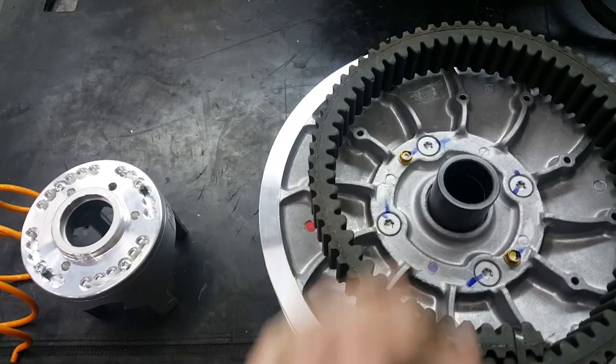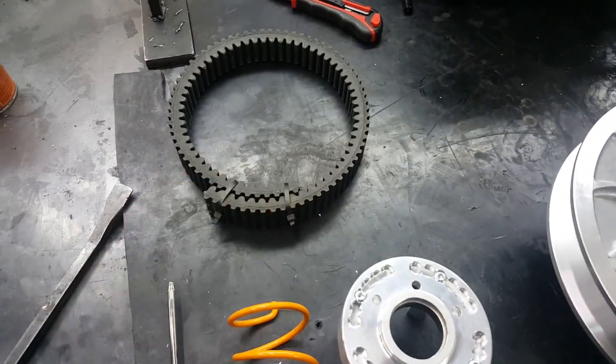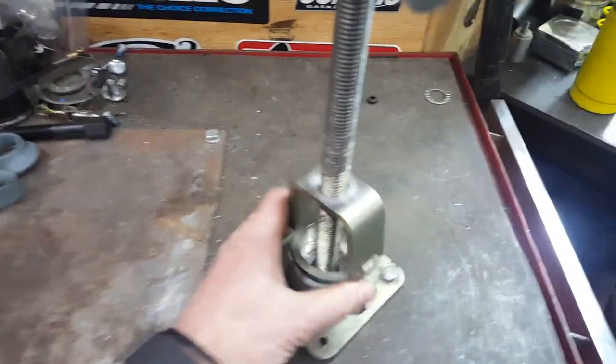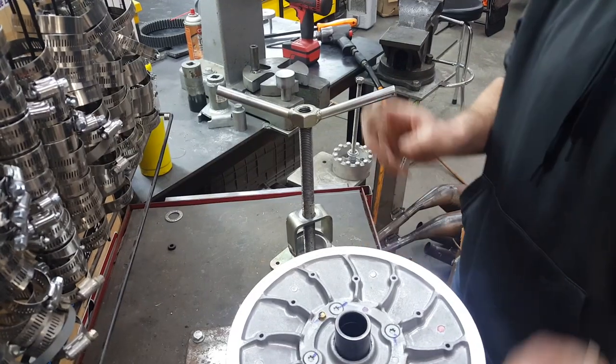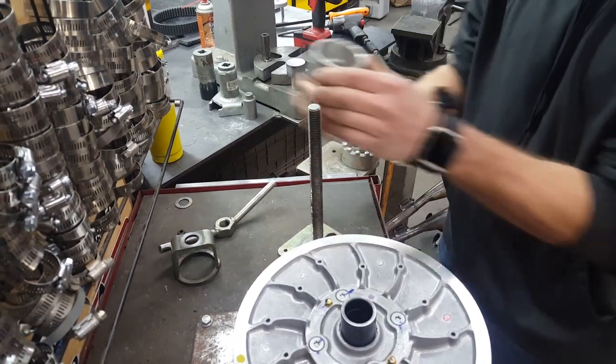I have this rolled-up old belt that broke and I have it zip tied. It fits inside of here when the clutch is upside down to space it — you'll see why later. You also need a clutch compression tool. I have this little pocket in here to aid in getting out the torx bolts.